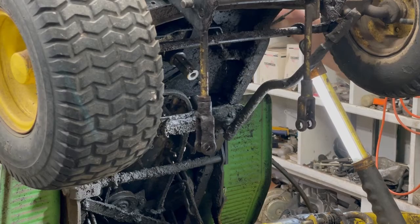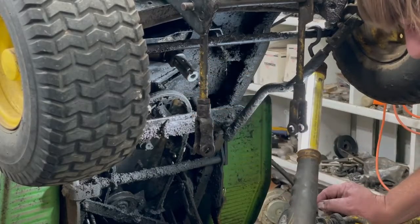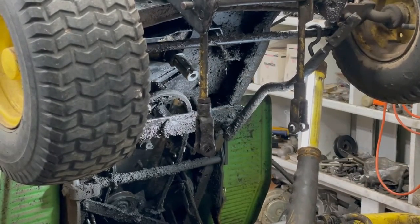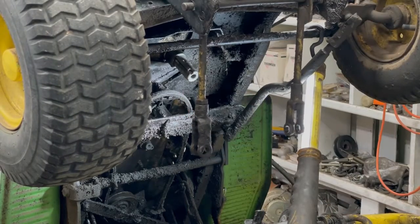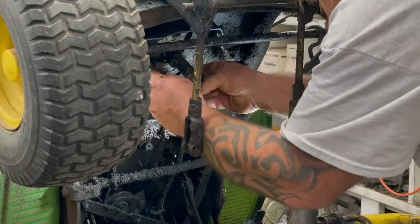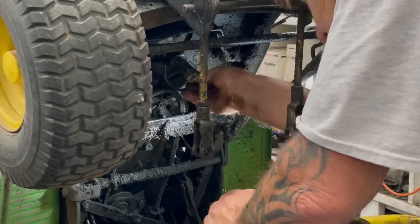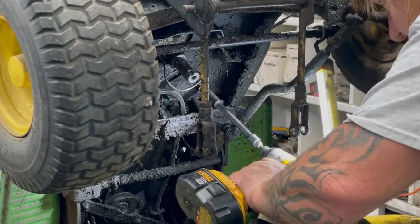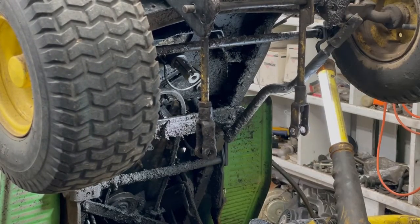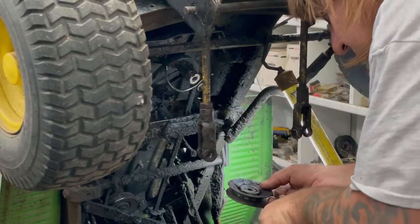Tighten this other front one here. There's supposed to be a wire guard that goes around here if I put that pulley on. I thought I set it right over here. Now I gotta find a nut for that. Got the wrench on the top. One more motor mount bolt to tighten down here. Alrighty, now I can put this idler pulley on here.